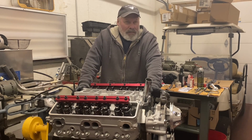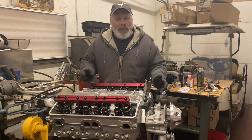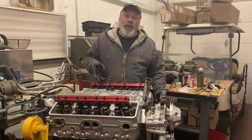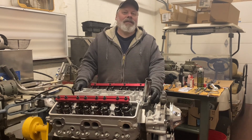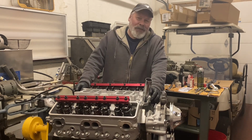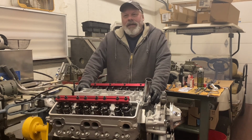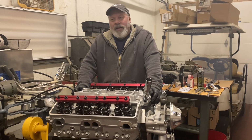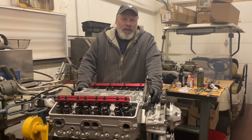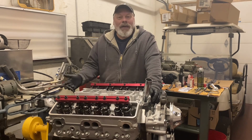It's a Melling 1055 pump that has a nice bolt-on pickup for an 8-inch oil pan. That all worked out perfect. You don't have to braze anything or TIG weld or make brackets for the pickup. It's not going to fall off. It's bolted on. It is a standard pressure, high volume, and again, no worries about the old wives' tale of pumping the pan dry. I have extra capacity.